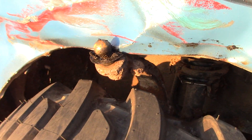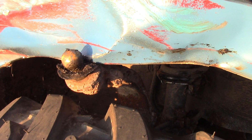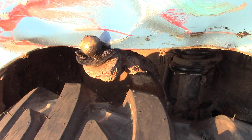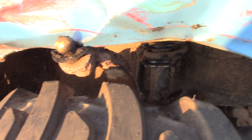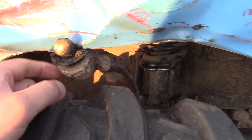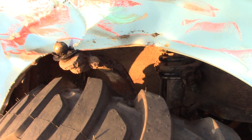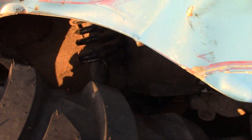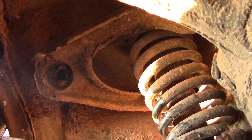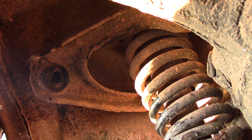There she is. This is the exact same thing that we had to fix on the wagon when we borrowed it from its previous owner. This upper ball joint is a weak spot on Hondas — everybody will say that and it is definitely 100% true. Obviously that's not a real stout connection. So how do you fix it? We're going to torch this off just like we did for the Honda and make this a bolt instead of that chintzy little ball joint. That part is bent pretty good as well, so we'll straighten that out, and this car's definitely got another run in it.